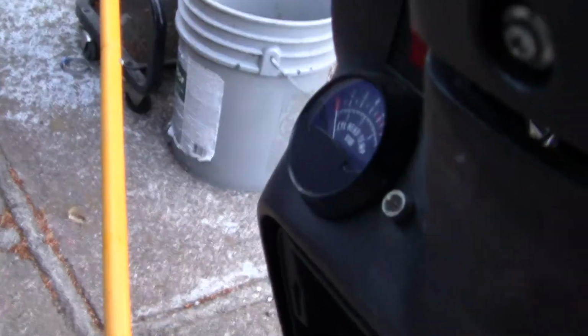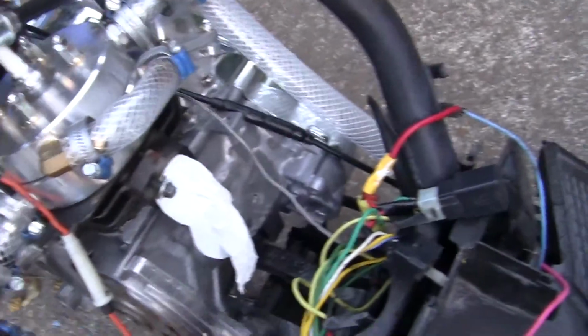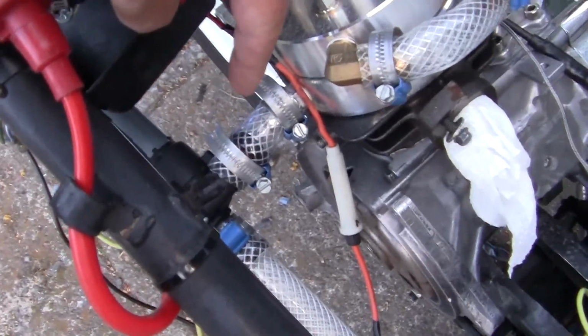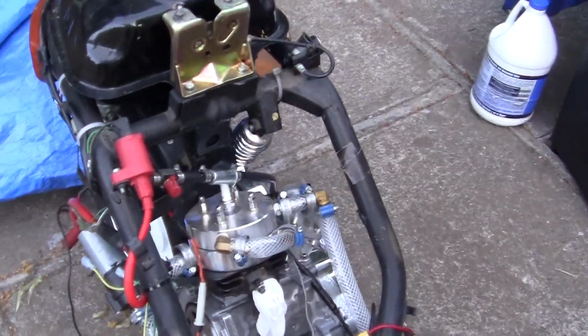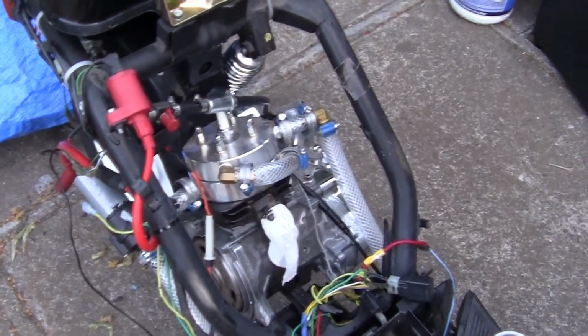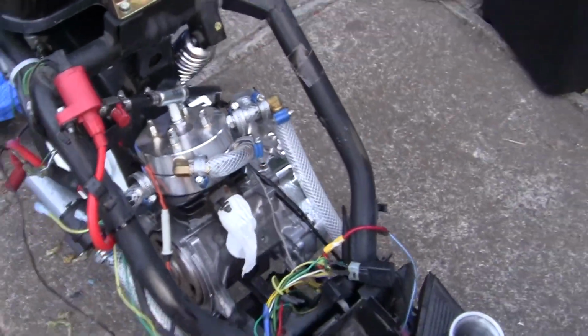And then I have to slowly turn the pump on and off right here with this button, it'll go zzz, zzz, and what that'll do is run the radiator fluid up into the head, and it takes a while for all the air bubbles to get out, because a lot of these heads have an air screw right here. This one doesn't, and that's fine.